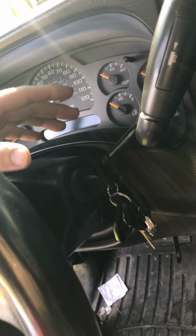With the ECM and stuff, everybody says you have to change that. I've done this, like I said, this will be the 5th one I've done. I've never had to change it. Basically, I unplug the transmission and all the stuff for the automatic that I'm not going to use, of course, because I'm swapping to 5-speed, and I tie it up and get it out of the way, so that way nothing happens to it. The only issue that I've had is that when you do that, it says it's in 2nd gear all the time, which is no big deal, it doesn't bother me, but some people are particular about it.